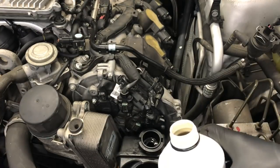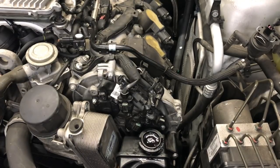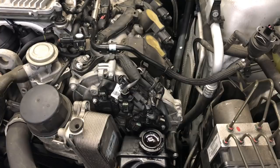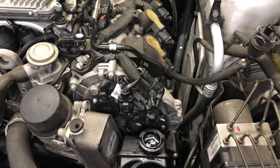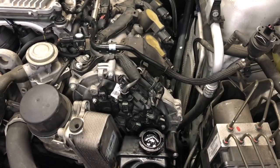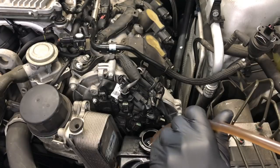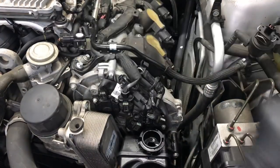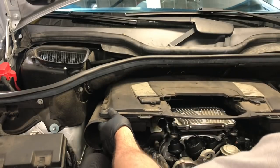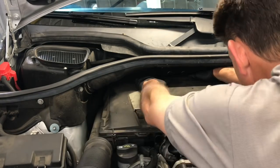Pour the fluid in until the reservoir is full to the top, then start the vehicle and the level will drop down, usually pretty close to perfect. If not, suck a little out or add more as needed. I had the fuel lines off earlier, so it took a while to start — yours should fire right up. Shut the vehicle off and double-check the level. If it's over full, suck a little out. The cap has a dipstick so you can check the level. Once satisfied, put the cap back on, give it a wipe-down, then put the air cleaner back on.